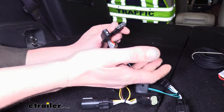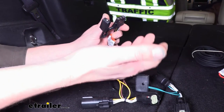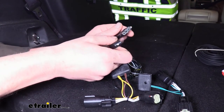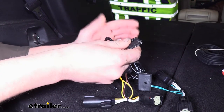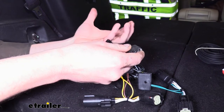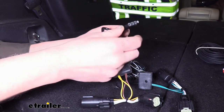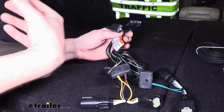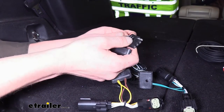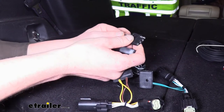What this means is that your vehicle circuits are not only powering the lights on the vehicle but they're also powering the circuits going to your trailer. So in the event that you have any fault on your trailer, or if you just have more lighting than your vehicle's circuitry can handle, you will likely open a fuse in your vehicle. This is going to result in a loss of lights — when the fuse blows you're not only going to lose all of your trailer lights but you're also going to lose the lights at the back of your vehicle, which could lead to an unsafe situation and could also lead to getting a ticket.